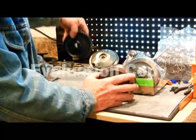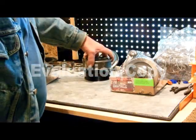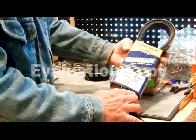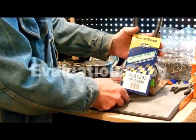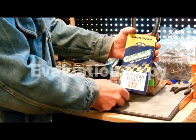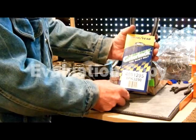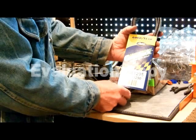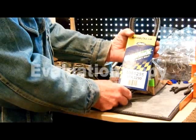One other thing — you don't have to change your serpentine belt. You use your original serpentine belt, and even with our larger pulley it still fits. The belt is the Goodyear Gatorback number 4081295. This serpentine belt is available anywhere — if you lose your belt and have the exhaust brake option, nobody usually has a clue what you're talking about, but this belt will work exactly the way you want it to work with your J-brake exhaust pump.